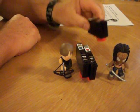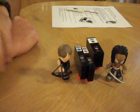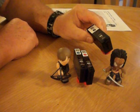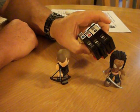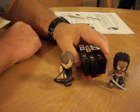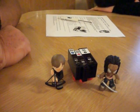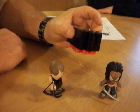The only way I know to get around that is to buy a new chip, stick it in there, refill the cartridge, put the cartridge back in, and then it's going to be fine. There's also some information out there that says these cartridges send information to your registry on your computer. Yes, they do, but that information is more or less just the type of cartridge, date, code, things like that. Yes, for all you privacy-concerned folks out there, that information is sent back to Lexmark. But erasing that information off your registry isn't going to stop the printer from not working. That information is in the printer — it's remembering what this cartridge is, how many times it's been used, and that it's empty.